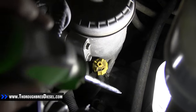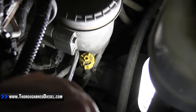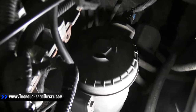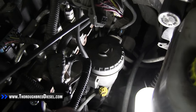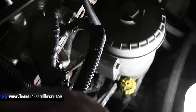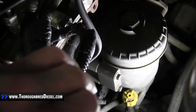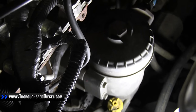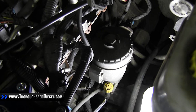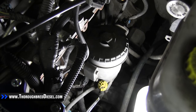While the fuel is draining, we're going to go ahead and loosen the three bolts that hold the fuel filter to the block — the 10 metric here, here, and then on the backside of the fuel filter that you cannot see. There are two electrical connectors on this fuel bowl, located right here and then another electrical connector right here on the end of my screwdriver. We will unhook those and then set the bowl to one side, and then disconnect the lines from it. Once I get the bowl laid out on its side, it'll give me a little bit better look at the connection so I can show you how to do those.